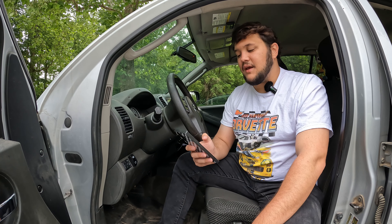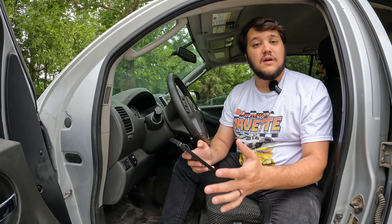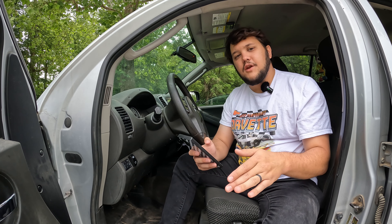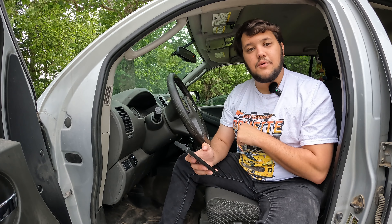The VPeak just got done scanning and it's actually showing no fault codes. Now, I don't have any check engine codes, so that is correct. I do have a code for my tire pressure monitoring system though, and it's interesting that it didn't pick that up. What I'm going to do is unplug my MAF sensor, start the Xterra to induce a code, and then we're going to run it again.